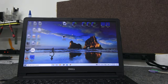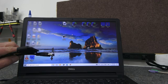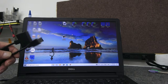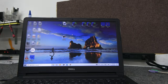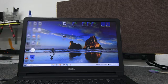I'm going to clone the hard drive onto a brand new Samsung EVO 870 2.5 inch SATA SSD. I'm going to show you the cloning process — we're going to use the free Samsung data migration software. I'm also going to use this USB to SATA adapter here. You can get these online pretty inexpensively. We're just going to plug it right into the drive like that.